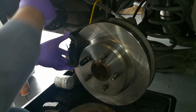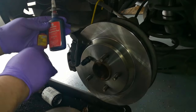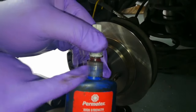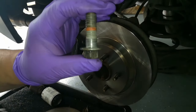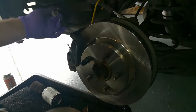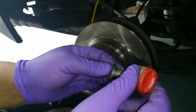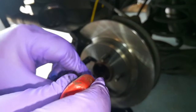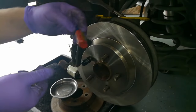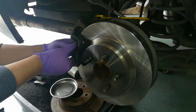Make sure you hand tighten the bracket bolts first. If you haven't done this many times, please use some thread locker — the blue is removable, and then you've got the high strength red. Apply a little tiny bit on the bolt and when you install it, it will basically keep it in place and lessen the chance of the actual brake caliper coming off at some point. Just a little tiny dab, kind of go around. Get your caliper bracket in place, lock tite on the bolts, and torque them to spec.